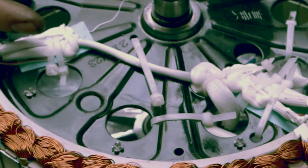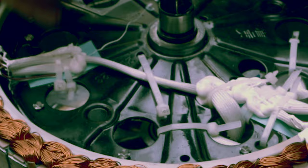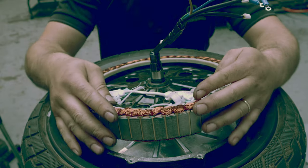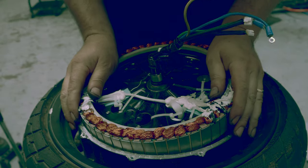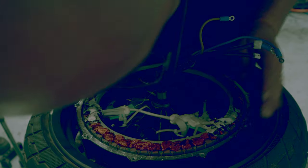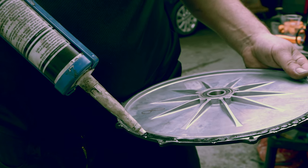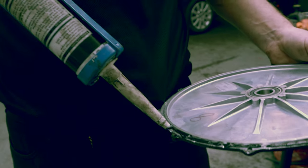Can you hear that? It works, and it's not a serious problem — it's just a cable that is hitting the metal every single time the wheel goes around. When closing it back, besides checking those cable ties for breaks, be really careful with your fingers because the magnets are so strong they just find their way back in. The new bearings you put in are RS bearings — RS stands for rubber sealing. After that, you need to put some sealant on the top part so water won't get inside again.